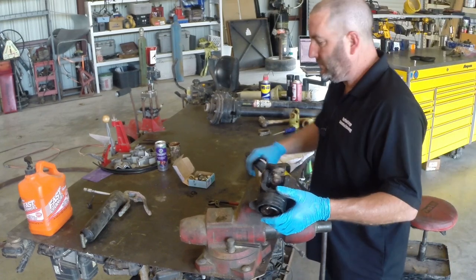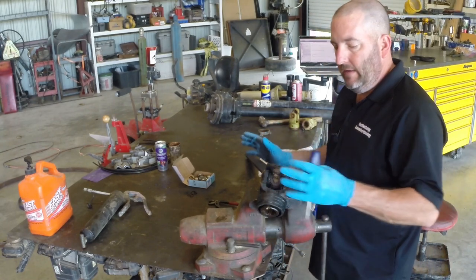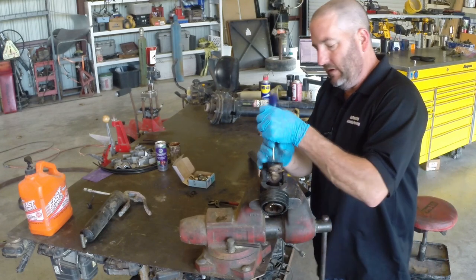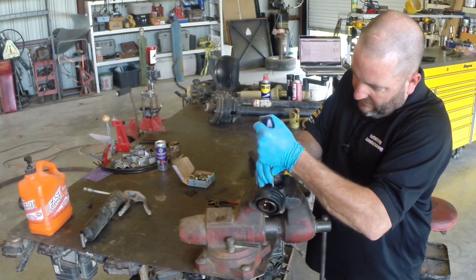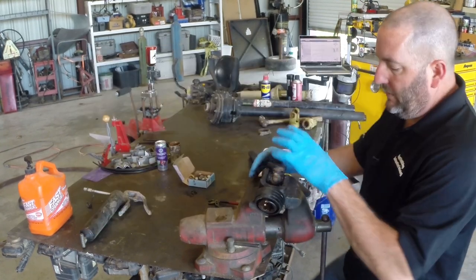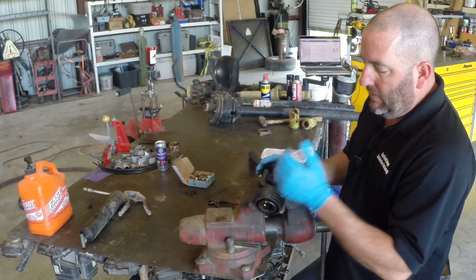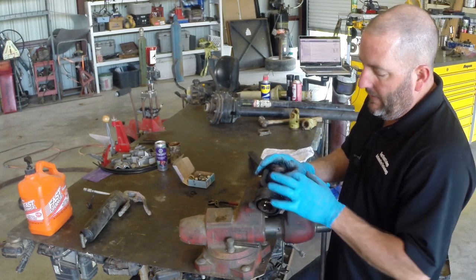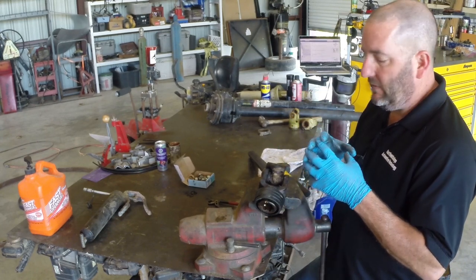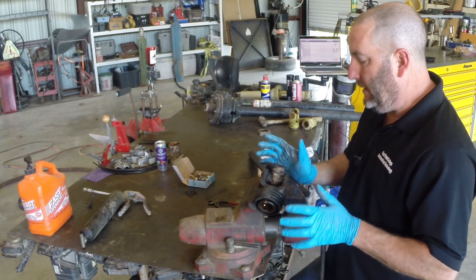Normally you would want to mark where each piece is on the shaft. These things are balanced and we want to retain that balance. I'm just going to take a screwdriver and scratch an X on two pieces so that when I put this thing back together I know where that X lines up. Same thing when you take it out of the car — TIS says to mark where the yoke came off the transmission or the flange for the diff, so you can put it back in exactly the same spot.